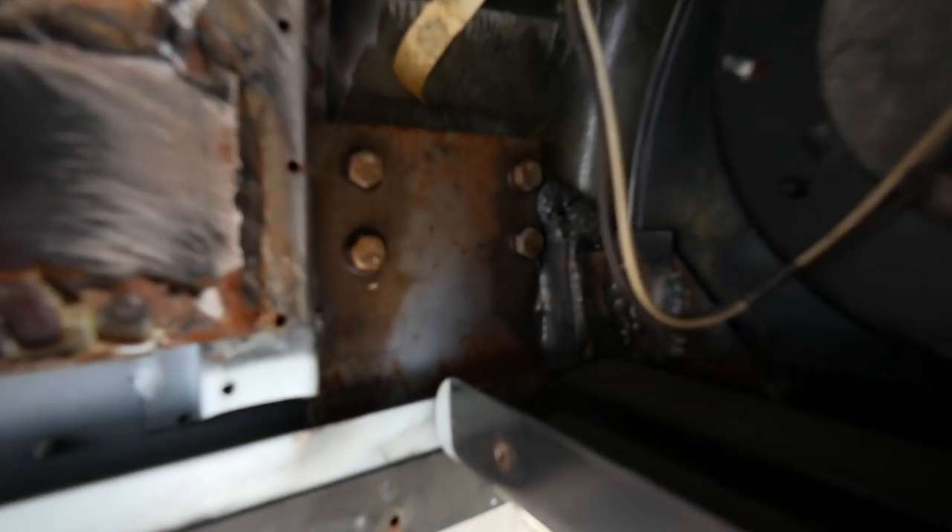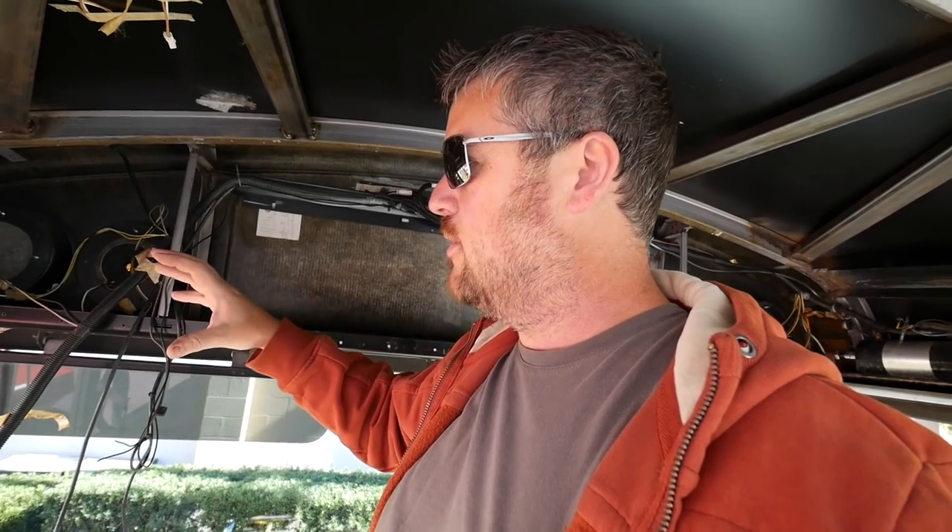For those of you looking to do a project like this, here's how I'm envisioning this. I think it's going to be almost impossible to raise this front portion up. There are a couple reasons — I was thinking about doing it that way, but my mirrors are connected to this section. They're actually bolted in right here. So if I lift this up, it's going to raise the mirrors with it, and then I'd be repositioning the mirrors and giving it structure and stuff. I just don't know if I want to mess with doing that.